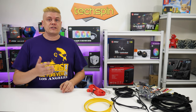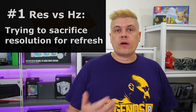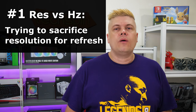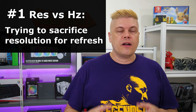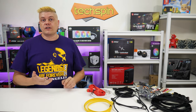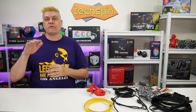The first mistake — and we get this question a lot — is can a 4K 60Hz monitor do 144Hz if you overclock it? Or if you drop the resolution down to 1440p, also called 2K, can it do 144Hz then? No, it can't. The monitor is built for its highest spec, whether that's maximum 4K resolution or maximum refresh rate.